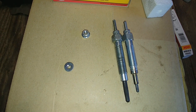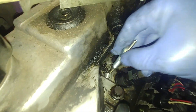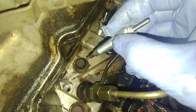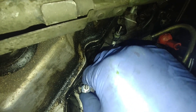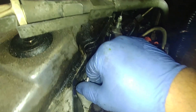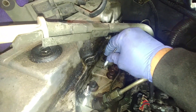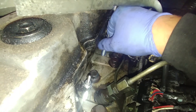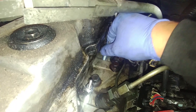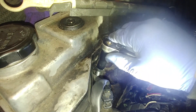That's the aftermarket NGK replacement part for this Delica — we checked the catalog and that's what's recommended, and it has good reviews. Always compare parts side by side. Now installing the new glow plugs — as Mitsubishi's manual instructs, always start by hand. Following the Mitsubishi Delica shop repair manual is really helpful. Start by hand, turn until it stops, then do the same for the second, third, and fourth glow plugs.